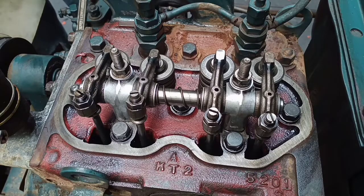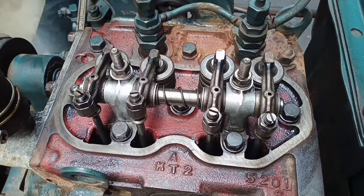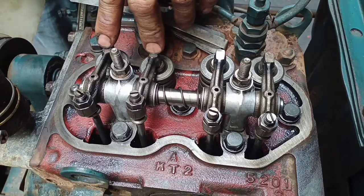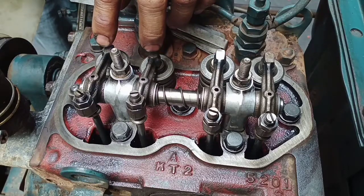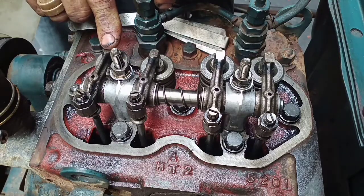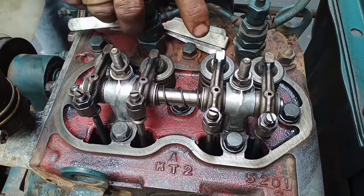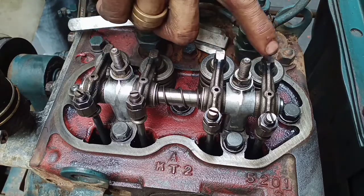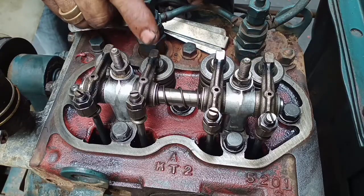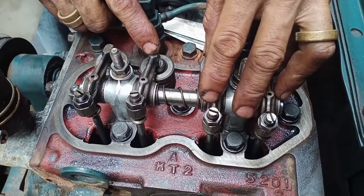Okay, let's start. How to tune up this two-cylinder engine. First, we need to know where the intake valve and exhaust valve are. This one is cylinder number one — this is intake and exhaust, intake and exhaust. Please take note: if the exhaust valve is open on cylinder number one, the piston at the top is cylinder number two.